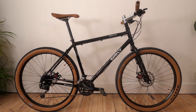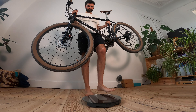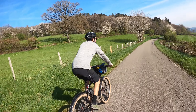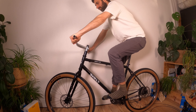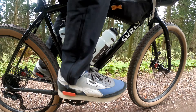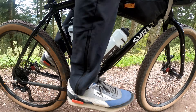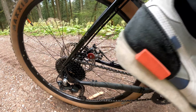Now that the bike is fully assembled I can do a weight check. Fully assembled, the bike weighs 14 kilos, which is not very light, but it's a touring bike meant to go off-road so it needs to be strong — I wasn't expecting a light bike anyway. The bike is ready to ride. For the size: I'm 1.83 meters or 6 feet tall and I'm very happy with the large size, although I'm pretty sure I could also fit on an XL with a slightly shorter stem. The bike feels really reactive when accelerating or climbing, which is partly thanks to the relatively short chainstay — the Bridge Club has 25mm shorter chainstays than a classic touring bike like the Surly Long-Haul Trucker.